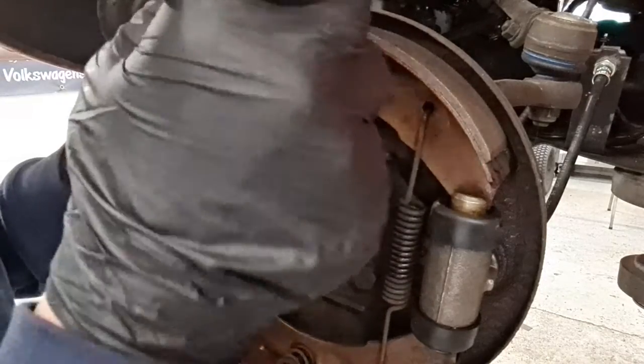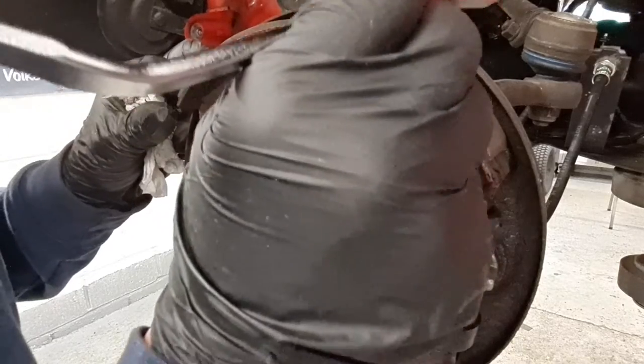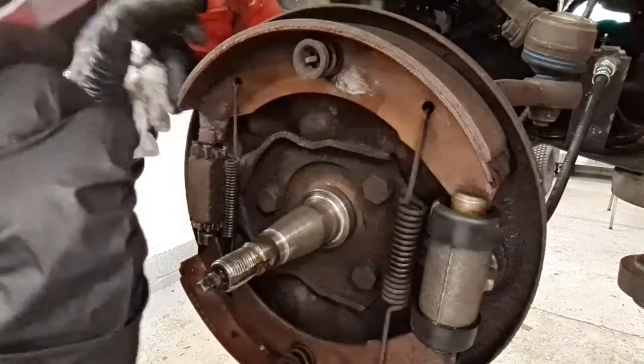If we only had partial contact, it could mean either there's a shape issue in the drum or the drum has worn unevenly after new shoes were fitted. So this is good across the whole width and the whole length of the shoe.